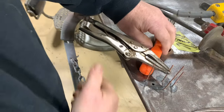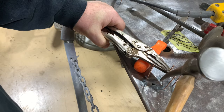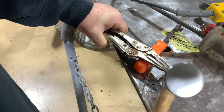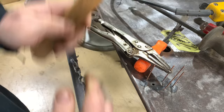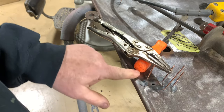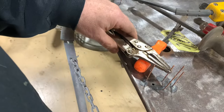There's still a little low spot in this area, so I'm going to put a little bit of pressure on that stud by pushing down on the vice grips and tapping around the stud — not tapping enough to put a dent in, but relieving it to get rid of the dent. If you end up with a little crown and you've gone too far, all you have to do is tap the stud back down and it'll push your panel back down and help you level it out. This was actually a really big dent — like it got hit with a golf ball three times. Now it's pretty smooth; it's gonna take just a little skim coat of body filler and that's all we've got to worry about.